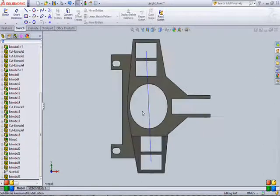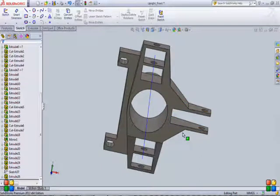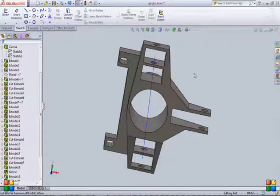We started from a basic curve which gives the location of the two suspension mounting points in 3D. I have accommodated both the kingpin angle, the caster angle, and the distance between the two mounting points in this one curve. I don't have to do any calculation while modeling my upright — all the calculations have been done and this simple line has been drawn. I then completely model my entire upright around this line. You can simplify your work by figuring out such methods where you don't have to worry too much about recalculating the basic parameters during modeling.